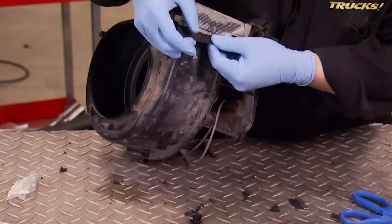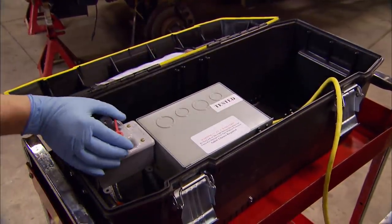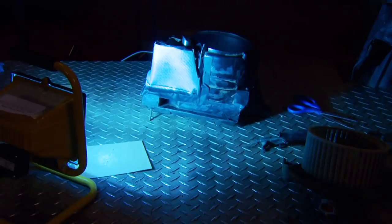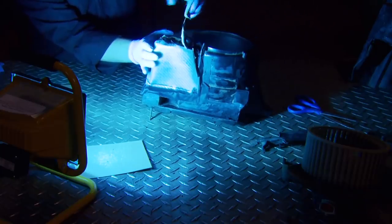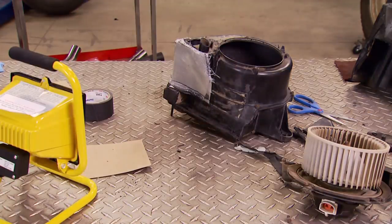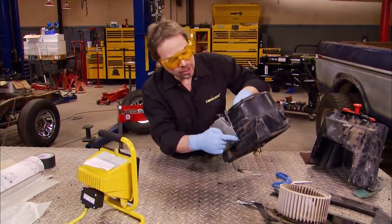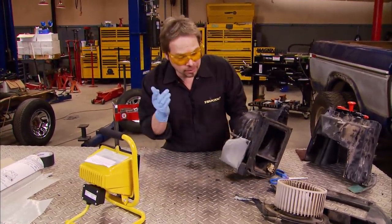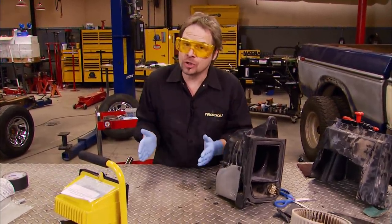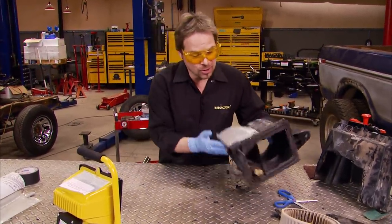A little bit of tape will help you lock things in until you expose it to UV light. You don't need a curing light to cure the Hyperfiber — you could just set it outside and expose it to natural sunlight. Our light is available from Percy's, but any ultraviolet light source will work. Harder than a frozen hot dog. All we've got to do is clean up the edge a little bit and throw a coat of paint on it. But remember — these glasses are part of the equipment, not a fashion statement. They're UV protective glasses, and if you get a cure light, don't even look at it. You can damage your eyes. Pay attention to a few basic rules — this is a wonderful new product.